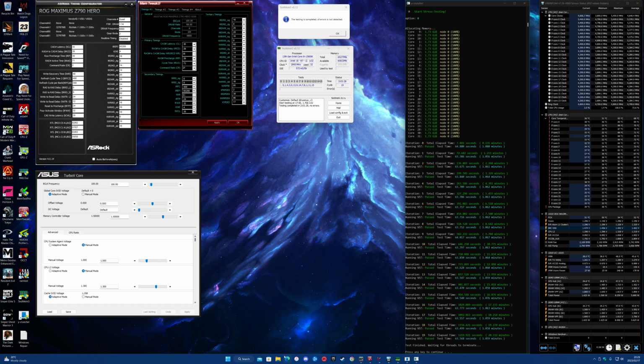And I was thinking, is this going to be the key, the breakthrough? Because now I can finally train higher values. Maybe I can do 7,400 and stuff. I did some testing, guys. 74 wouldn't train at all under any circumstance. And that has to be down to IMC limitation, just like the board limitation. So 74 dual rank can't even train. That's almost like 8,000. 74 dual rank is as untrainable as 8,000 single rank. It's the same kind of feeling.